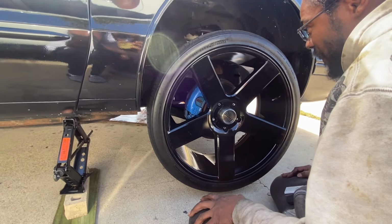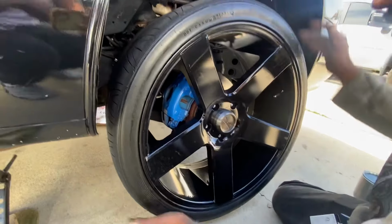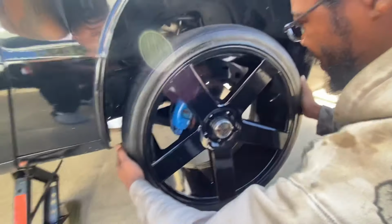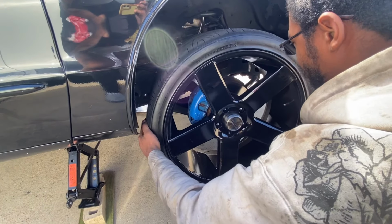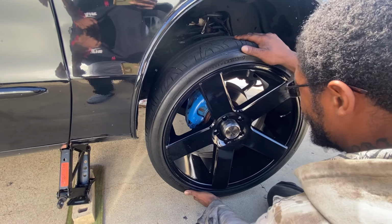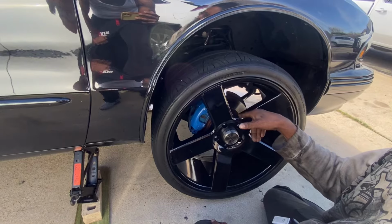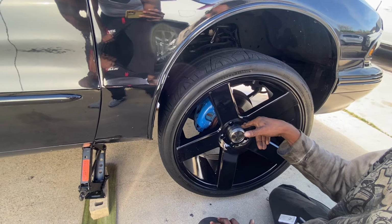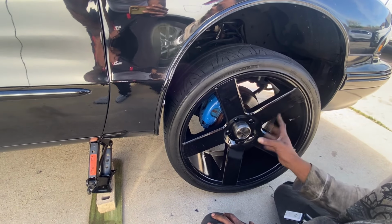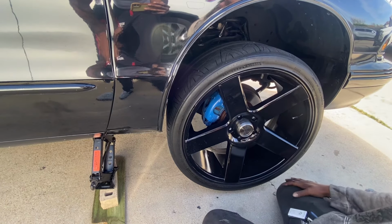So what do you say about the hub, though? What part of the hub is messed up? I see the control arm. When you wiggle it like this, there shouldn't be any play. This way is your rack and pinion or your tie rod, and this way here is your hub. When that snapped, it also popped the bearings in that hub. If we replace the control arm without the hub, then in about a week or so you'll hear nothing but grinding from your tire while it's turning, because the bearings are off. So it's the control arm and the hub we have to replace.